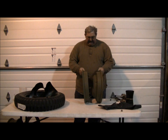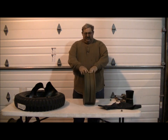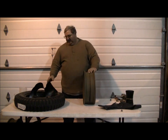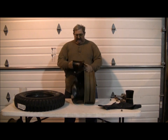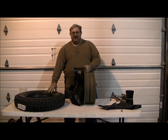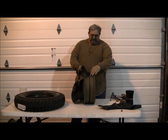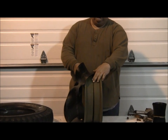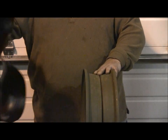The two halves of the wheel, as they bolt together, will leave a seam in here. So to replace the bead separator today, we use a tire flap. The tire flap is a heavy piece of rubber which will go inside the tube, inside the tire, and it will protect the tube from going up in between these two halves of the wheel. That way, you won't pinch your tube and get a flat when you're assembling the wheel or driving it later.